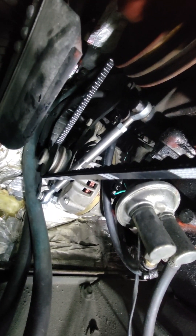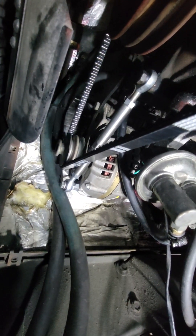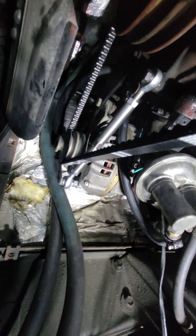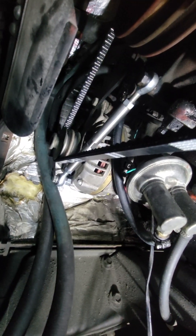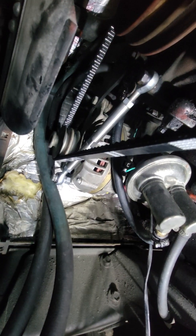You're going to need to either get a spacer or use two nuts, and you'll need an extended bolt. It was M8 x 1.25, and a 2-inch bolt — that gives you enough length to get in there and seat properly into the alternator.